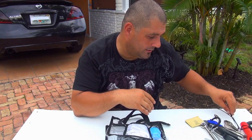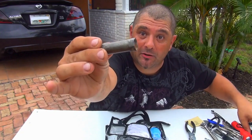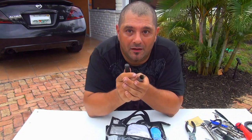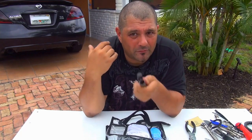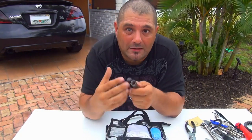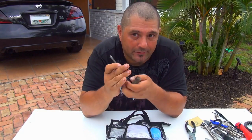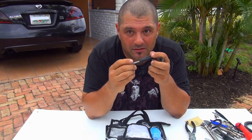Open up the paper clip, make it straight, flip the carburetor around, and you can clean the main jet without forcing too much. Don't damage the main jet — they're made of brass, a very soft metal. Take a few paper clips and place them inside the bag. Now, something really important: you're going to need the spark plug remover. Sometimes the spark plug gets dirty, or the gap gets too wide.